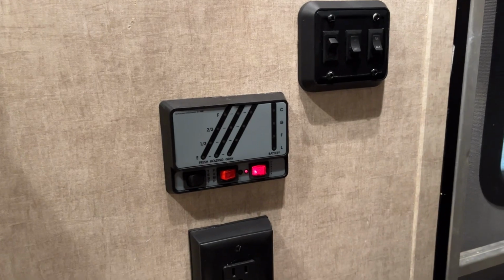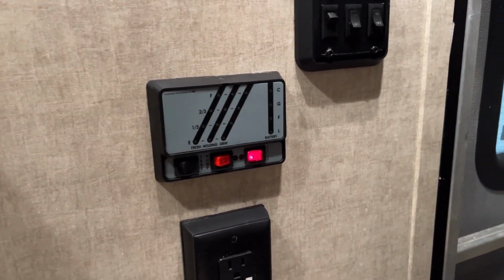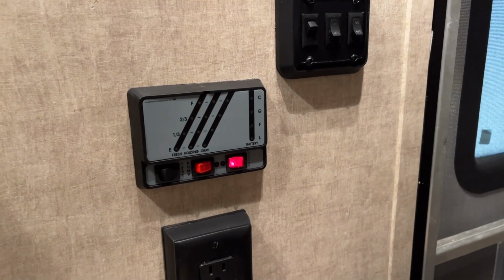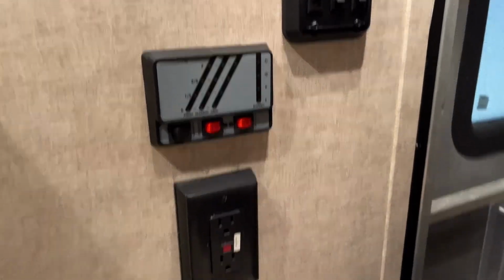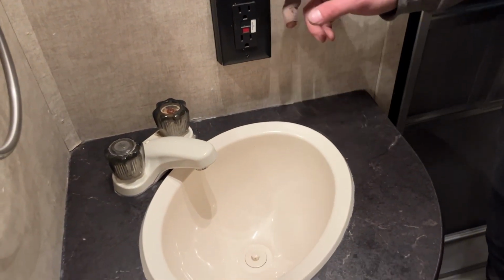So there's the first try, it's done. Let it do the second try. Standing right here, you can hear the whir of the flame, so we know that tank's good. Underneath, we get your GFI protected outlet. Test on the bottom, reset on top. If you ever have outlets that don't work, it's the first thing you should check.